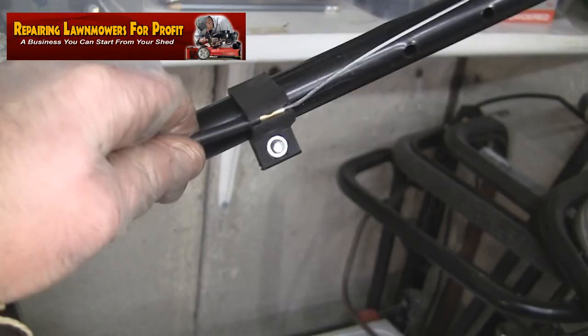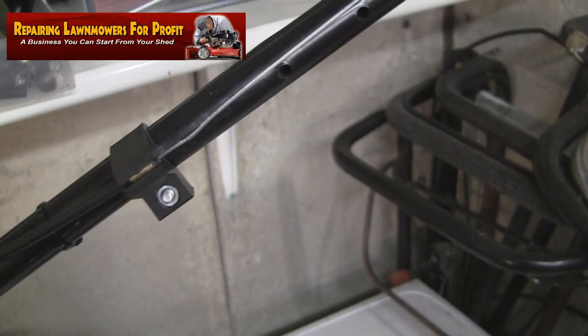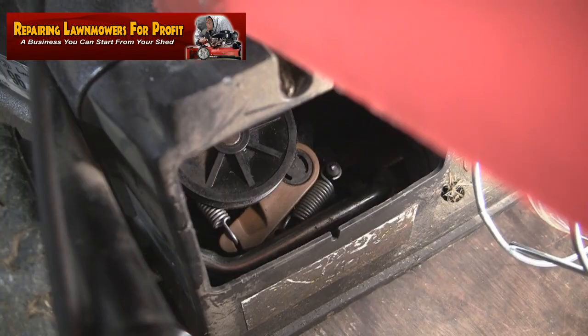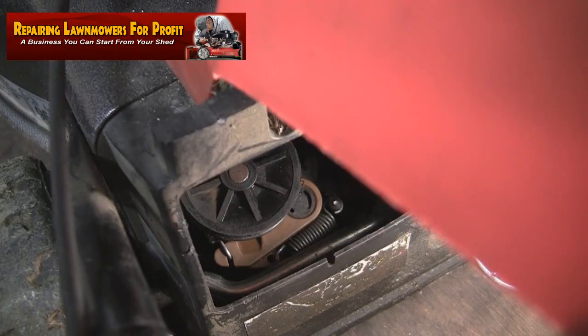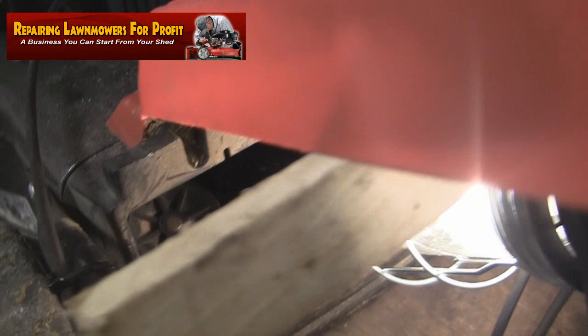So you must make sure that when you're trying to do it at the back of the transmission box, it feels like it's pushed in nice and solid, and then you pull this cable through. I've just put that into the handle — as you can see it moves up and down about an inch. We'll take a look at the back of the mower just to see if the transmission appears to be working okay. It's now operating when I use the lever. Just a note: the cable on the handle won't change the speed — the box is set to the speed driven off the engine via the belt. If it's not tensioned enough it won't pull and your lawnmower won't drive, so that's the thing to check first.